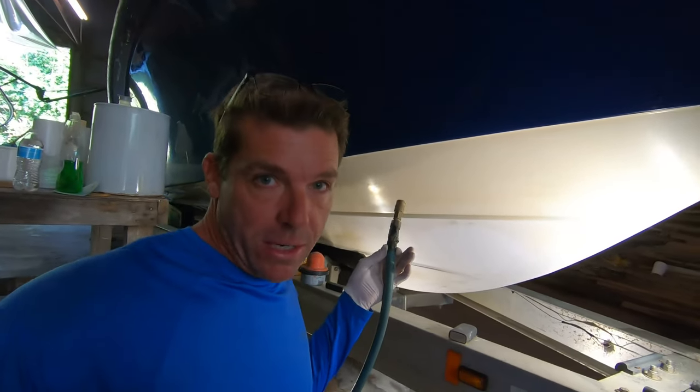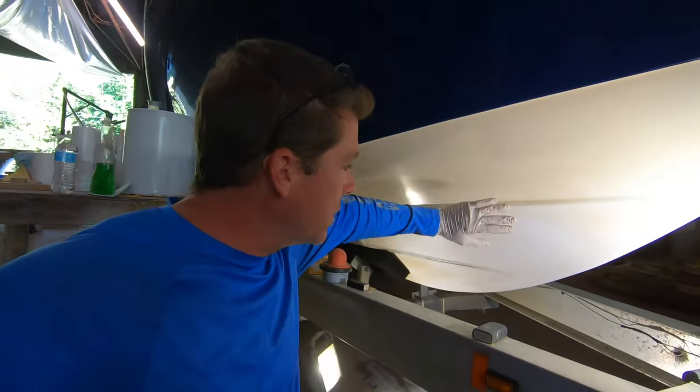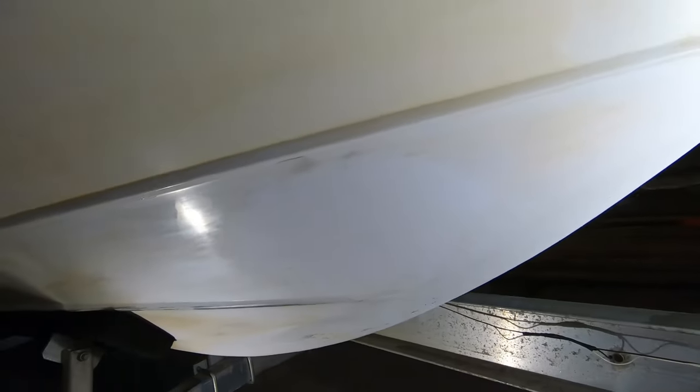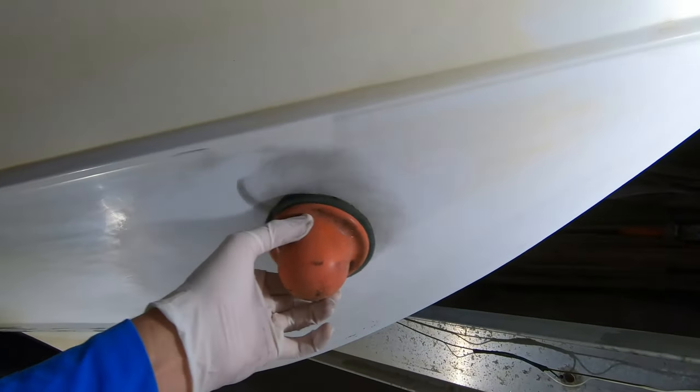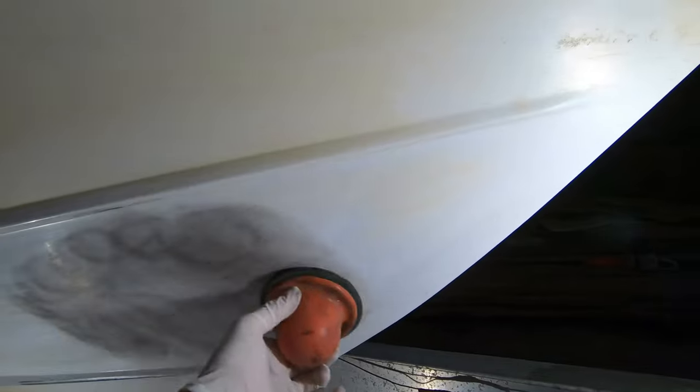One more step I wanted to add: I've got compressed air here to blow the surface off. After wet sanding, wash it with soapy water and use compressed air, a dry towel, or a hair dryer or heat gun to warm it up. Every time you sand with a progressively finer grit, the area you sand is going to get a little bit larger. That's where the guide coat really helps — it shows more prominently in the area you've been wet sanding, so you know exactly where you've covered and where you haven't, rather than shooting in the dark.